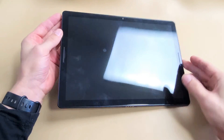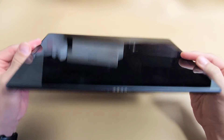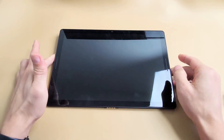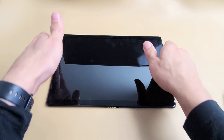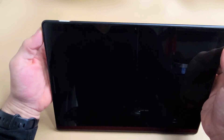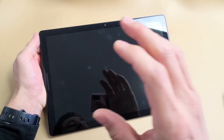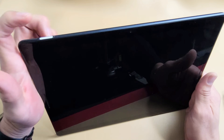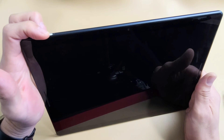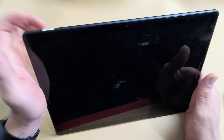If you're still down, the next thing is what I call the freezer method. Take your slate naked with no case and put it in your freezer where it's nice and cold. Leave it there for 15 to 20 minutes. After 15 to 20 minutes, grab your cold slate out of the freezer and tap on that power button to see if your screen is on. If it's still not coming on, while it's nice and cold, do the same thing with the power button again — press and hold for 10 seconds, let go, count to 10 seconds, then press once to turn it back on.